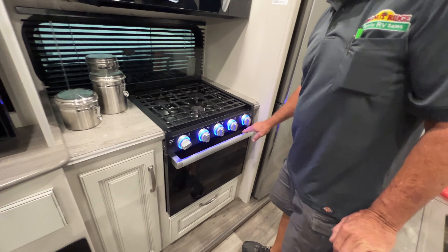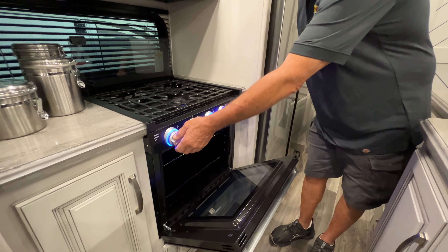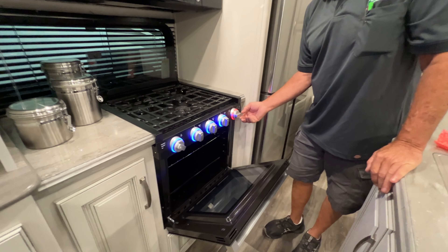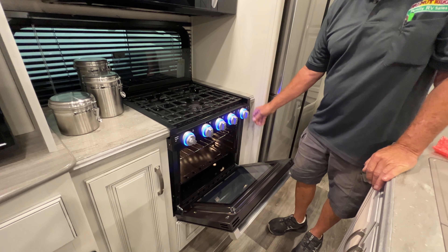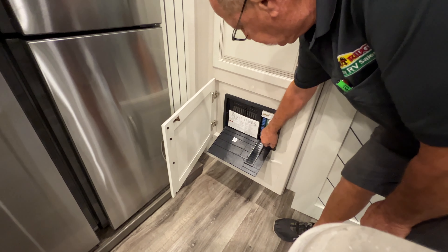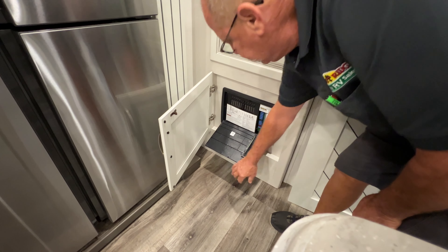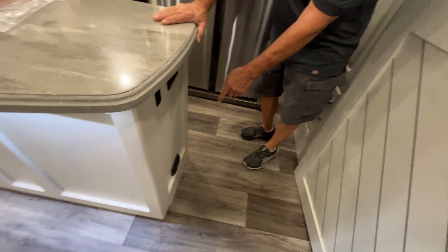Looking up here — it's a microwave when you come in. This is AC only. All these lights are DC. This is the fastest way to tell if you've got power to your unit or not — if this is blank, just start looking; you're running strictly off your battery. On the stove, we don't have LP in our tanks right now, but all you've got to do is turn this. Right now, if I turn it to my flame and click it — if we had LP on, we'd be getting flame. That's how we light it. If you walk in, you don't have flame but this is red, I'm bleeding LP into my unit right now — make sure you turn it off. You'll light the oven by going to this one. Once it lights, you're going to continue to hold it for a minute, then turn it to your desired temperature — you're good to go. Up here is your light switch: middle is off position, down is your oven light.